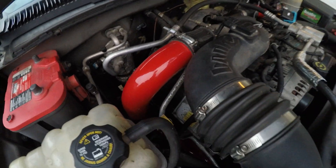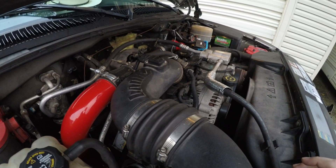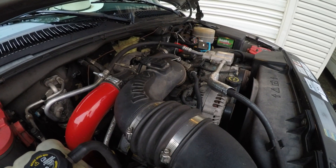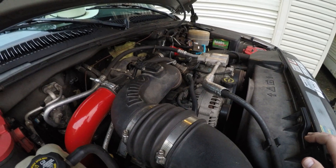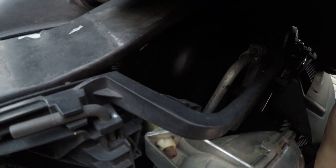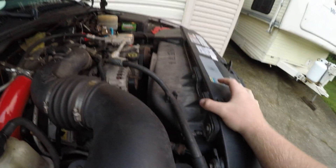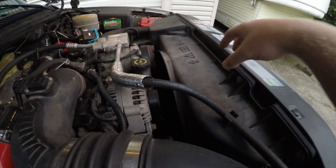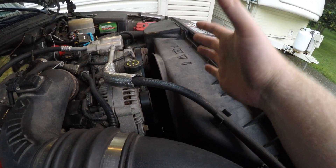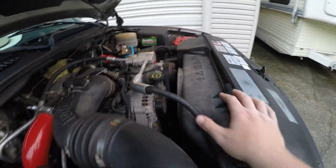Here is the cold side. What I love about everything I've shown you guys so far is that under the hood, this truck looks factory. The boost tubes are red and the turbo is black, but that's pretty much it. The intercooler is hiding underneath this plastic panel and that fits just like stock too. It is thicker than the stock one, but Banks truly got every bit of space they could in that thing. Because the intercooler is thicker, it does push the radiator back a little bit, and now the fan is fully inside the shroud — so there's a little bit of extra cooling potential there.